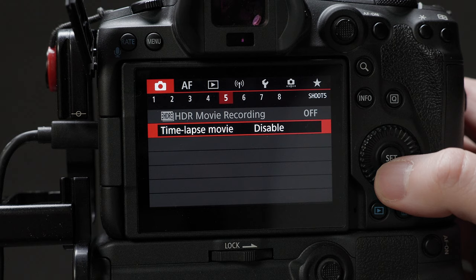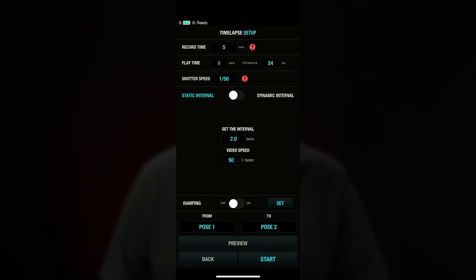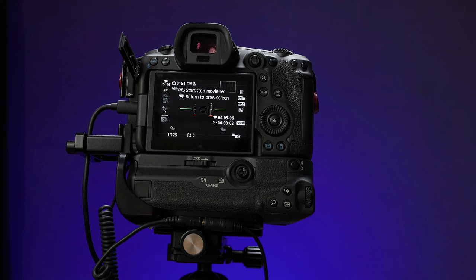In testing, I found that as long as the recording time was longer than five minutes, any interval worked fine — even the minimum of one and a half seconds. But below that, I almost always ran into problems even with comparatively long intervals like four or five seconds. Third, if your camera requires you to specify a frame count — like the R5 does in timelapse movie mode — add a few extra frames over what the Edelkrone app calculates you'll need. This gives you a bit of extra padding to manually start the recording and in case things drift. Finally, if you want to synchronize your recording with the slider as much as possible, plug the camera into the motor module and use the first frame to start your recording. Just make sure you disconnect the release cable after the first image, or the slider will stop your recording when it goes to make the second image.